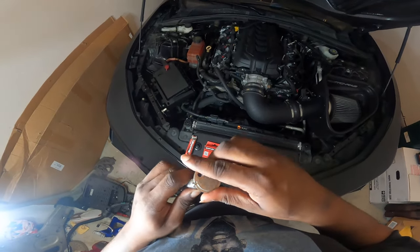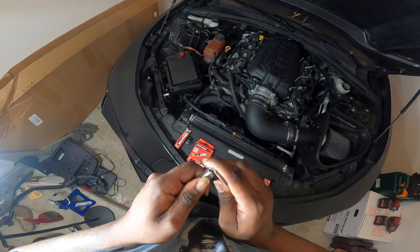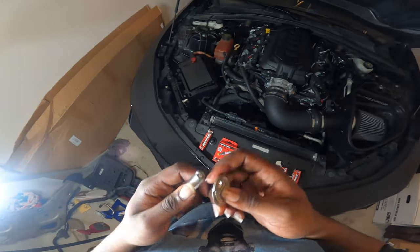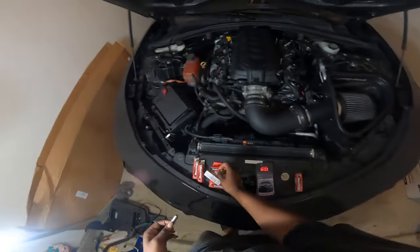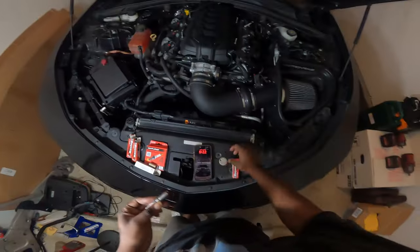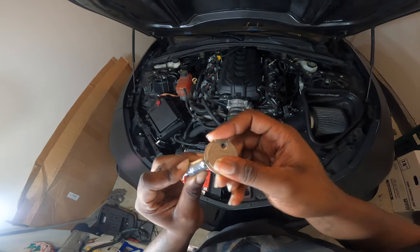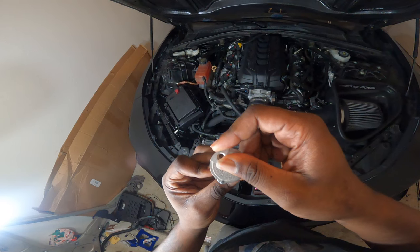Pry that up just a little more. We did way too much that time, so when you close the gap you just push it up against the tool on this end. That didn't close the gap for me though. The gap on this one was way too big — I already gapped another one and made it good. Get yourself a little bit of a hard surface and tap it down gently, then go check your spark plug gap. It is working a little bit.